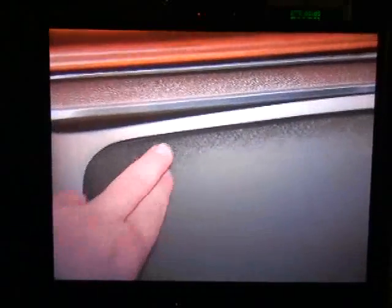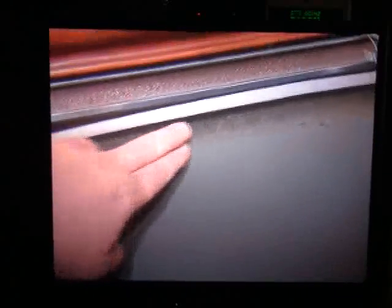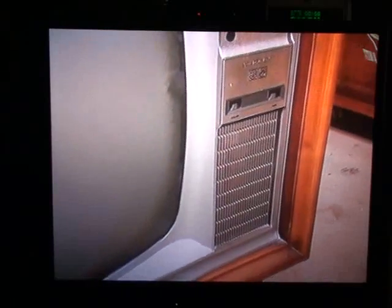What exactly is cataracts? Well, it's very easy to identify. We have this delamination appearance around the perimeter of the CRT. Upon first inspection you're going to think all you have to do is pull the lens off and clean it — it's probably just dust. Well, that's not the case. There's a PVA material — polyvinyl acetate — which is a clear bonding material that bonds the lens to the face of the CRT. Over time this bonding material breaks down, most likely due to the presence of oxygen. The edge is closest to the ambient air, so ambient air and oxygen have an impact on the aging of the PVA material.